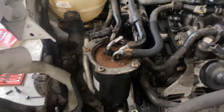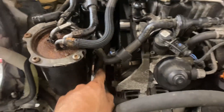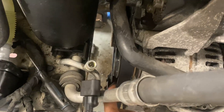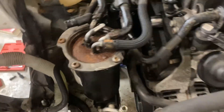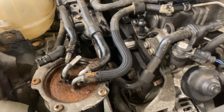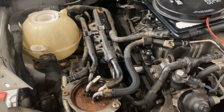Filter's changed, new O-ring on the head. There's a little bit of rust in there but nothing too aggressive. It's a good time to mention that coolant lines, your nice new timing belt, and your new serpentine belt aren't huge fans of diesel — so make sure you don't spill much if possible. Now we're going to get to priming the system with jumper cables.